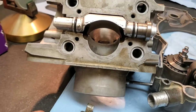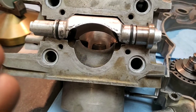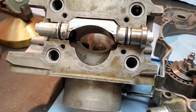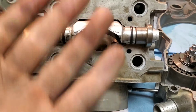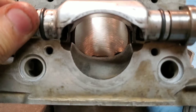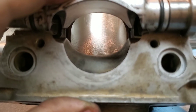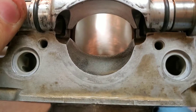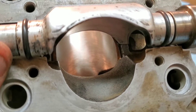That's necessary because an engine needs a specific amount of back pressure — resistance from the exhaust gases — to function properly. When the piston is moving up and down at low RPMs, it has more time in which it moves from here to here and pushes the exhaust gases out of the cylinder. So if it were open all the way at low RPMs, the pressure from your exhaust gases created in your exhaust would be less than what is created here. And then as you rev up your bike, the power valve opens up — the amount of back pressure required is exponential relative to the RPMs.